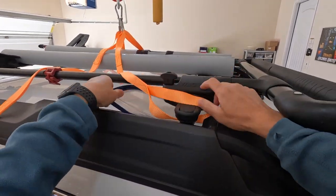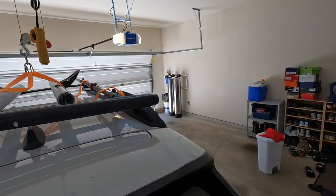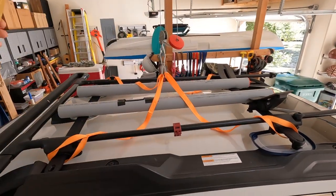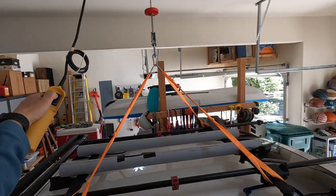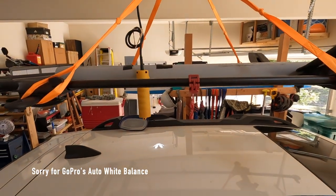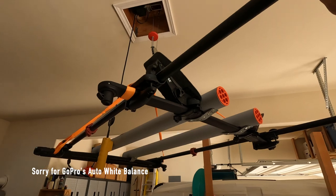I also put some plastic lids under the latches. This is to prevent the latch falling into the connection assembly and locking itself before I lift the rack. I've seen people use the electric winch system instead of the electric hoist for this operation. I wouldn't recommend that because most winches are designed to pull, not to lift. They may not have a proper braking system.